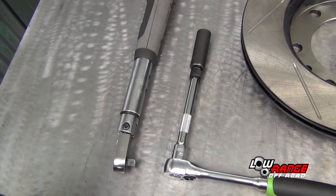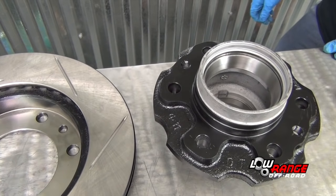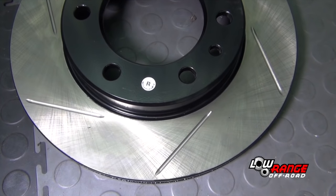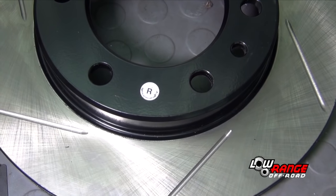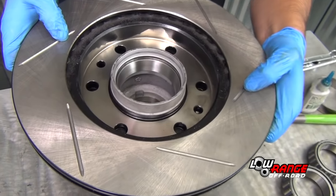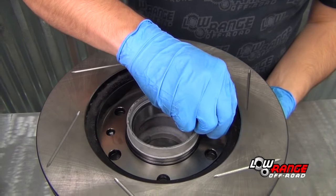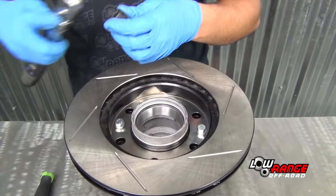Next we'll show the installation of the rotor on the hub. The tools and parts needed are: a torque wrench, a ratchet and extension with a 14mm socket, a brake rotor, the hub, and two bolts and lock washers. Note that some rotors are side specific — for example, this rotor is designed to run on the right or passenger side of the vehicle, so be sure the hub this rotor is attached to is installed on the correct side. Position the rotor on the hub and align the holes. Place lock washers on the bolts and install them through the rotor and hub. Snug the bolts, then torque them to 38 foot-pounds.